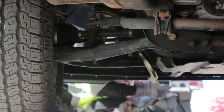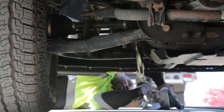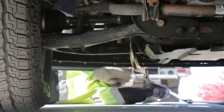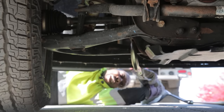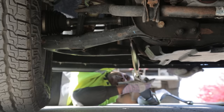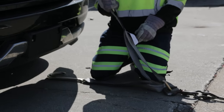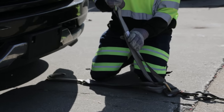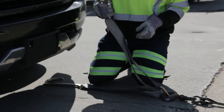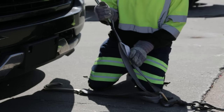The strap passes the front of the lower part of the clip, giving your winch cable and hook plenty of space and plenty of clearance. The soft strap allows you to not damage or scratch any of the trim on the bottom of the truck. Whenever hooking your vehicle, you always want to remember to have your straps straight and flush, because you don't want to jeopardize the structural integrity of the strap — it could break.